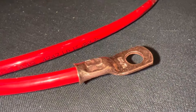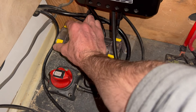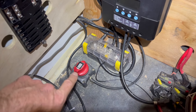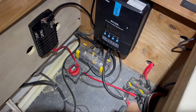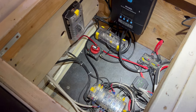Here's the first cable connecting the fuse box - you can actually use the hammer crimper even on 6 AWG. To connect the positive I shut off the lights and the breaker. Oh my god - I forgot to shut off the solar panels first. Apparently if you still have juice flowing in and it's not going to the batteries, it can burn this thing out. I flipped the switch but should have done that first - oops. Got the positive to the breaker, negative to the negative bus bar. Always disconnect your solar before disconnecting from the batteries.